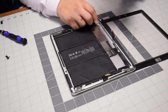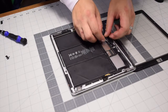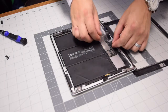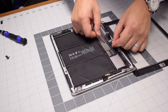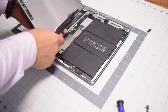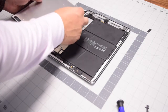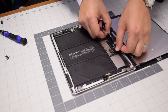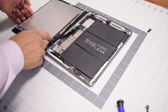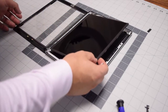For reassembly, follow all steps in reverse. Reconnect the home button cable first — that should be relatively easy; make sure not to forget the eyelash. Then reconnect the digitizer data cables, popping them in until you can't see the white lines anymore. Use the back of the tweezers to apply pressure and close the eyelash. Now reinstall the LCD — lay it down on top of the digitizer, tuck in the LCD cable until you can't see the white line, and push in the eyelash to secure that connection.